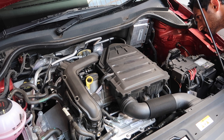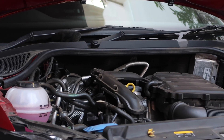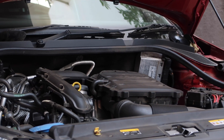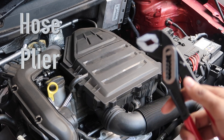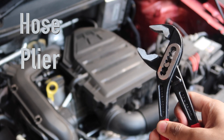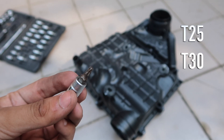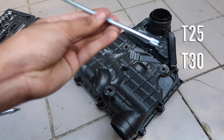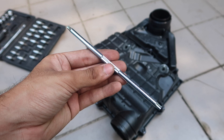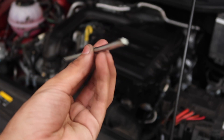If you're more of a reader, I've linked my detailed Team-BHP thread on this service in the description box below. To perform this service all you need is a water pump or hose plier to take off metallic hose clamps, and a T25 and a T30 Torx bit for taking out some screws. We're in luck since Volkswagen have surprisingly bundled a screwdriver in the boot — it's a T25 and a T30 at the other end, which is absolutely brilliant.